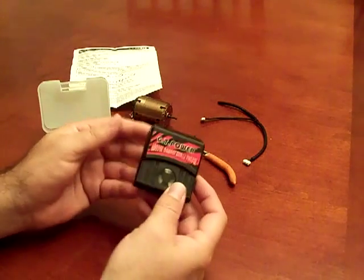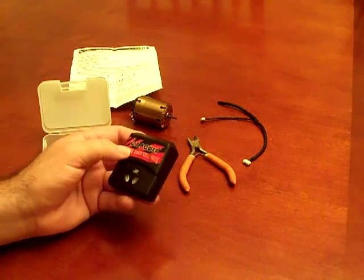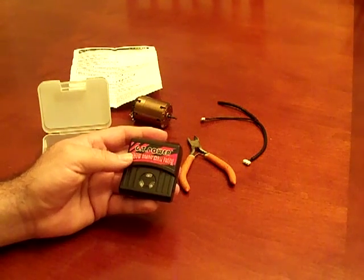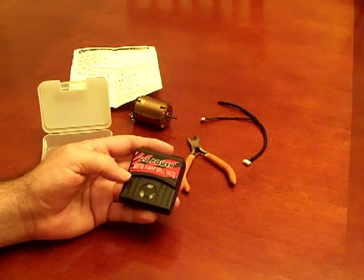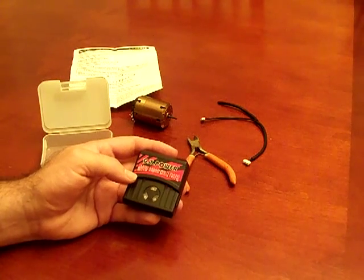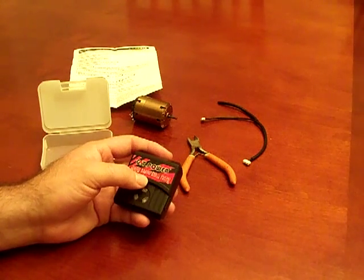The instructions for using this are quite simple. Basically, the reason why you would want a product like this is to be able to troubleshoot to see if there's something wrong with either your motor or your sensor wire. It's very common during heavy racing for a sensor wire to break, and that would be the first thing to test. Under rare circumstances, the hall sensor inside the motor itself could potentially be damaged as well. So this will help isolate the problems.